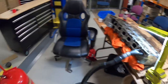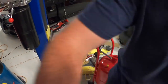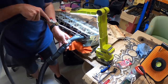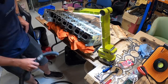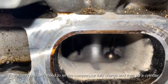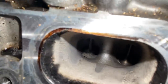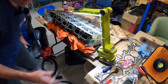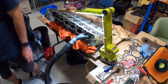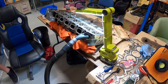I just noticed the pressure gauge was right down to zero — I'd left that off. Now that the compressor is actually on — that's how quick you can clean the valve. One valve done. I'll let the compressor charge up again and then do the other valve. The Aldi compressor is probably a little bit underrated for this — I've got about 100 PSI on the compressor with the regulator set to 60 PSI going into the walnut blaster.